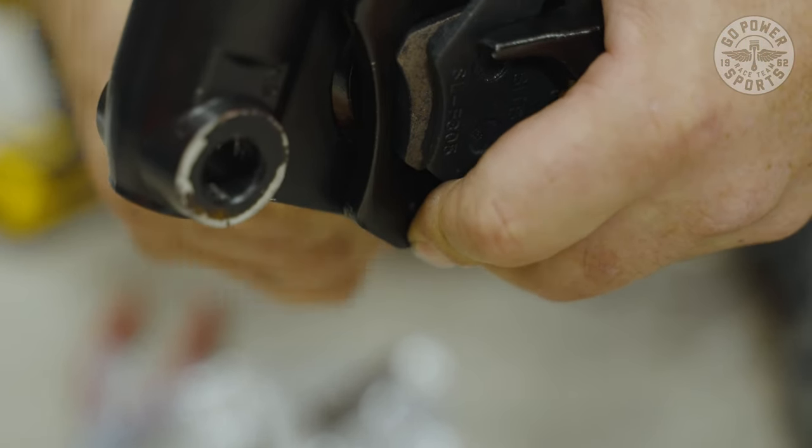All right. On occasions, some of these are bent one way or another. Make sure that these do not touch here or here. If so, you will need to adjust here on the bracket. You can grab them and bend them accordingly one way or another if they are offline. Okay, now that we've already done the fender, we're going to add the front tire on, and then we're going to add the brake back on, and then we're going to go on to the handlebars.